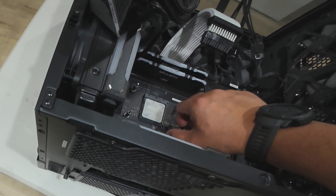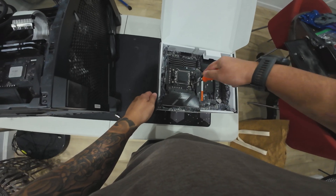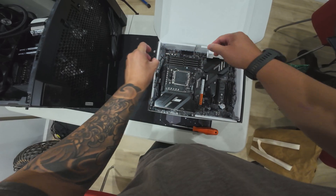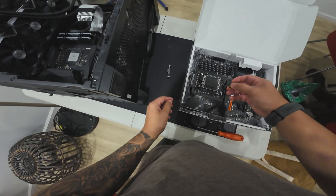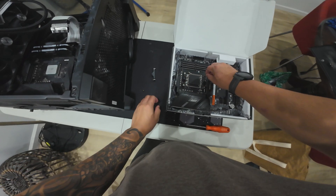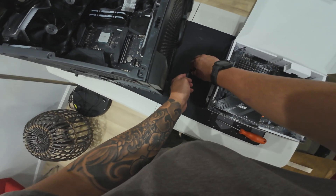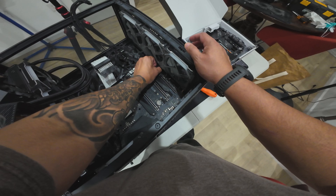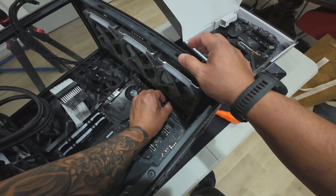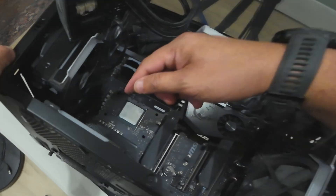At this point we are ready to remove it. The old motherboard doesn't have the bracket for the CPU of the newer motherboard, so we removed the bracket — this is just a regular CPU cooler and it didn't come with any CPU. Now we're removing the screws — the mounts for our water cooler on our old motherboard. It's very easy because it's hand tight. It's critical that you pause a little bit so you don't lose track of where the bracket went. Be aware of what your current CPU cooler needs to adapt to your new motherboard. We're removing the wires — the picture we took is very critical at this point since we can see what part of the motherboard it was hooked up to. We're removing the main CPU power and we're about ready to take this out.